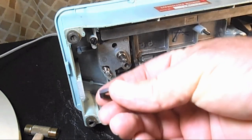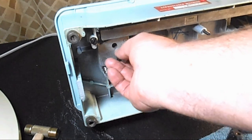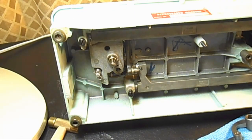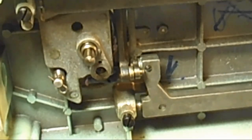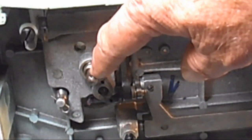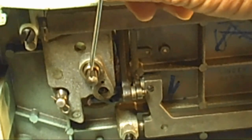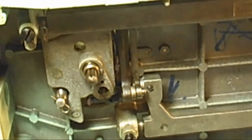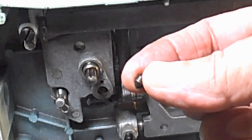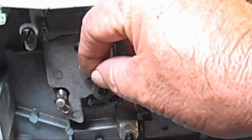The first thing you start is the flat nut that's going to go back on here, righty tighty. And wait a minute, let's see, before I do that, maybe you'll be able to see this, get in closer here. In this hook shaft there's a V groove cut into it right here, and when you put the bell crank back on it, you remember me saying that that pointed set screw, when you put that in, it has to line up with that V groove, and that's called the timing mark.